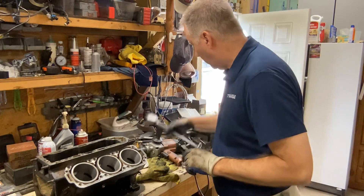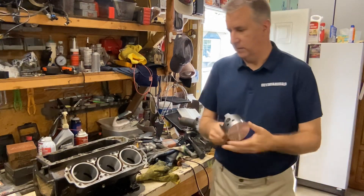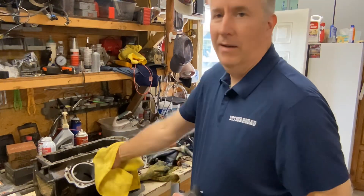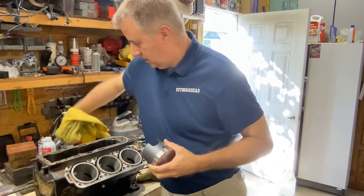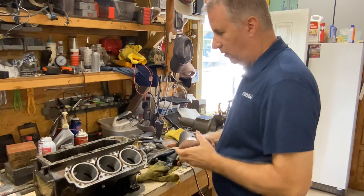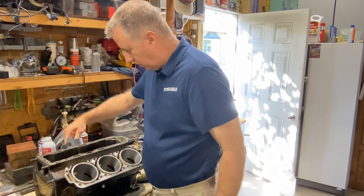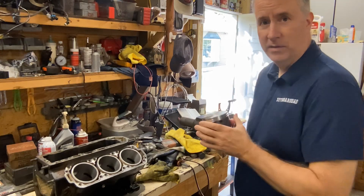Let's do one more test. A machine shop guy taught me to always double-check things. I'm going to take my new piston and a cleaner rag — the rag I've been using is full of grit and dust, so I want to keep this as clean as possible. I'll wipe these two cylinders out and see if the piston fits. Because if it's the same size as the piston at the skirt, the top of it should start to go in a little bit. This was the one that measured at zero — the top of the piston goes in, and the skirt is grabbing right now. So now we know our measurements are accurate.